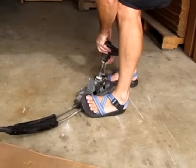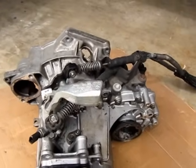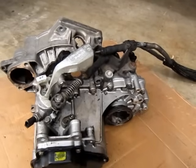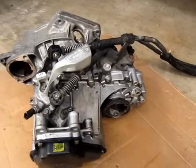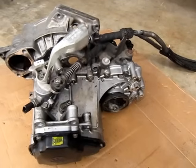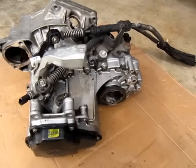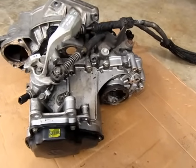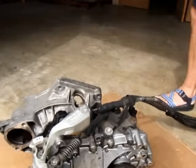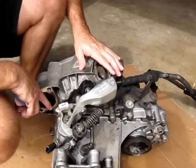Go back inside the car, pull the pin, and then cycle the shifter: first, second, third, fourth, fifth, reverse. It's first and second that are critical — if you get it right in first and second, you're going to be good everywhere else. Go down to first, second, and then you're done. You've achieved alignment without having to use the locking pin.